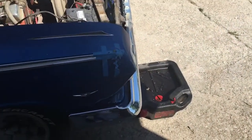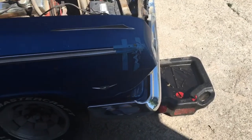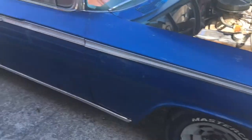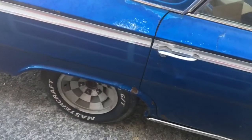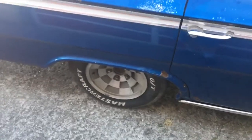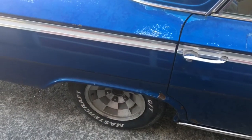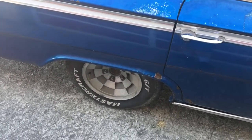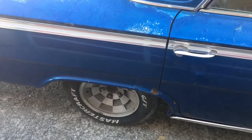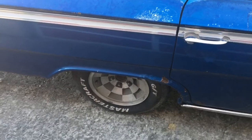Okay, well, got that. That's empty — that was amazing because they're always full. I think I just filmed that scene in slow motion. In my car video that I didn't get to put on there because of storage issues, I talked about this tire. They've been going flat every single day because the tires are all weather-checked from sitting around for 20 years. But I put in some of that green slime stuff and the tire stayed up for a whole week — pretty good deal.